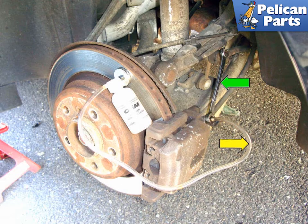After each wheel, check the fluid level in the brake fluid reservoir and refill it if necessary. Properly tighten all bleeder screws and return any wiring stays and rubber caps as well.